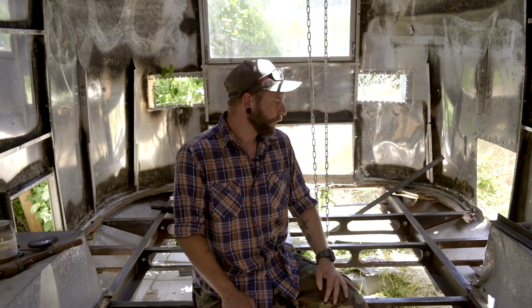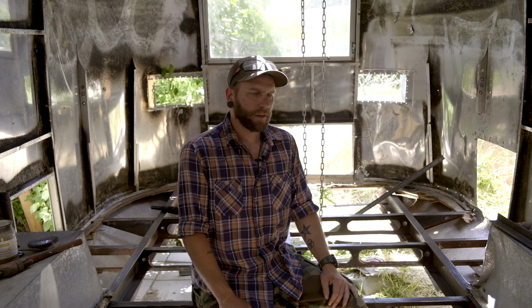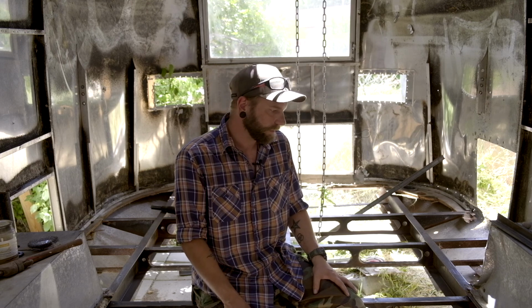I think I mentioned before, but the previous tank used to hang below the trailer, which was nice for up top as a flat surface, but these Airstreams ride pretty low, and I'd rather have the clearance, because when I went to take that one out, it was all busted up from hitting a low spot in the road and smashing it. I'm going to be taking this into some pretty hairy places, I'm sure. So I'm going to mount it flush to the bottom of the frame. It's going to stick up a couple inches above, but that's okay for what's going back here. Not a big deal. I'd rather have that than damaging the tank. So stay tuned. We're going to get some welding on and some grinding, and we'll go through a list of the tools that I'm using right now.